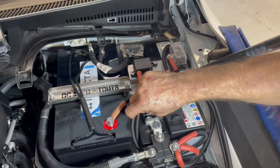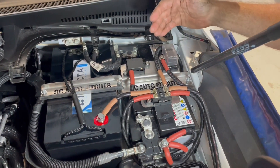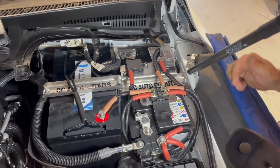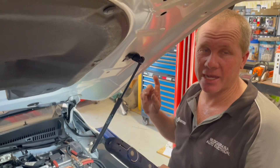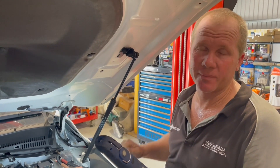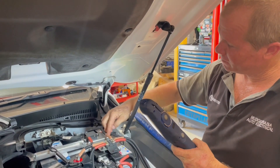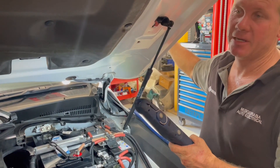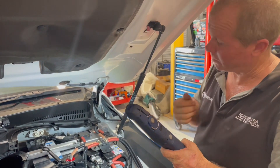When you complete this, you would cable-tie and group it all together nice and neat. This is a great setup because for guys with tow caravans, you can run power circuits out of here for fridge and charging, spotlights, UHF, all that sort of stuff. We also have a remote fuse box kit mounted in the back — six-way up the back to put all your accessories. That's what this extra wire is here, feeding off this midi fuse, so it's protected through the midi fuse as the main feed to the fuse box, then six-way fuses up the back to power whatever accessories you want.